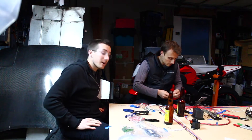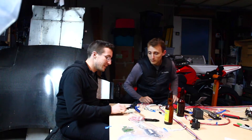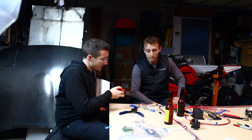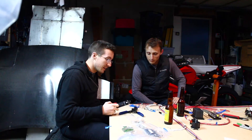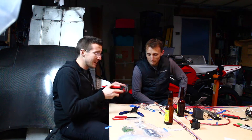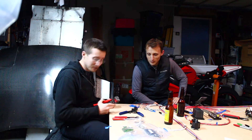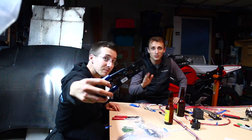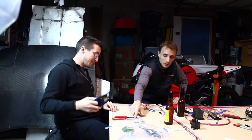Pro tip if you're doing your wiring harness: invest in good tools. We're finding our cheap, generic parts store wire strippers aren't good enough to cut through the shielding on this tefzel wire, and the automatic wire stripper I normally use for a lot of projects is also not cutting it — it's damaging the shielding. Before you get involved in a project like this, definitely invest in the tools. We got a fairly expensive weather pack crimper, and that thing works awesome — works every time. The cheap parts store wire strippers, we might as well throw them away.